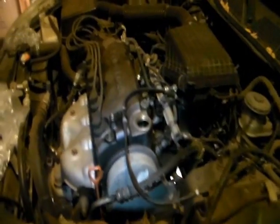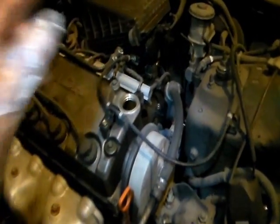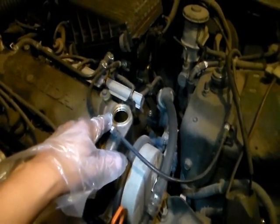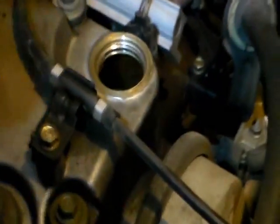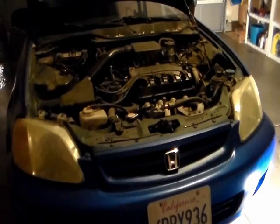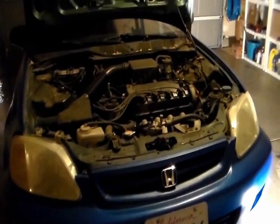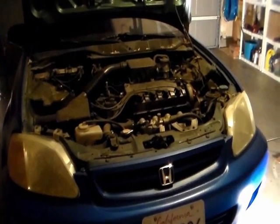After about 14 hours of putting the oil pan back onto the car, I removed the oil cap. I removed the oil cap so air could go into the engine freely, because air is needed for the silicone to dry. So I opened the cap so more air could go in. It's been about 24 hours. So I'm gonna put oil in the engine, start the car, and see if there's any leak.